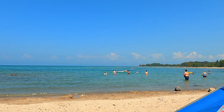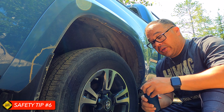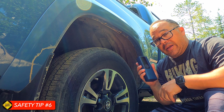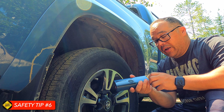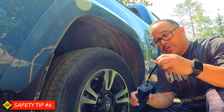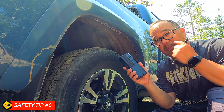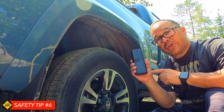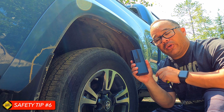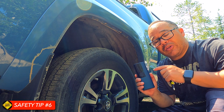The next safety tip: always check your tire pressure before going on a long trip — both your tow vehicle and your trailer. Invest in one of these battery-powered tire gauge monitors and inflators. I got mine on Amazon — the battery on it can handle at least 16 to 20 tires for checking and inflating. I'll put a link in the description. Always check your tires and make sure they're at the rated PSI before you go. It makes a huge difference for safety and for towing.